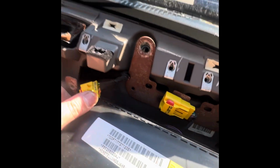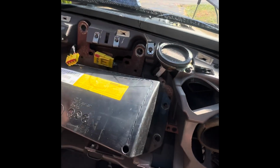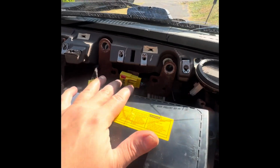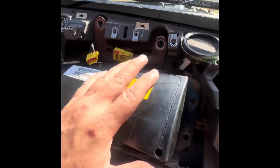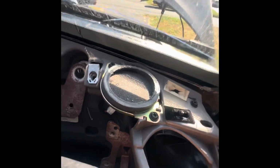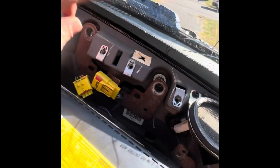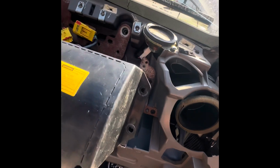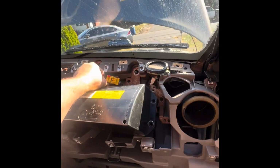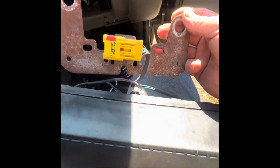But then that plug is attached to that bracket in the back, which has 2 big screws with 13mm heads and 4 little screws of 7mm. So that's undone. So hopefully now it comes out. I removed it because I suspect those 2 big screws have to come off anyway to be able to remove the whole dash, pull the dash this way. But anyway, I need both hands, so I'm gonna get this done. There it is, guys. It came right out.